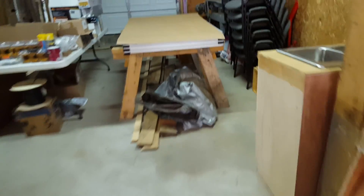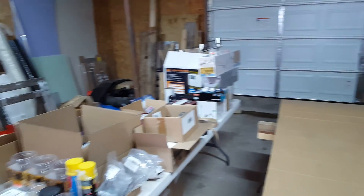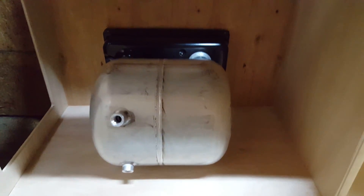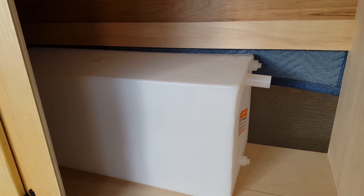Here are our solar panels — I've got four panels, and those will go up next week. We've got a bunch of light fixtures and all kinds of stuff back here. Here's one of our cabinets — this is where the hot water heater is going to sit, and it's an RV-type propane heater, six gallons. These are our overhead cabinets, ready to go. Our large cabinet is under wraps right here. And here is our potable water storage tank under this cabinet.